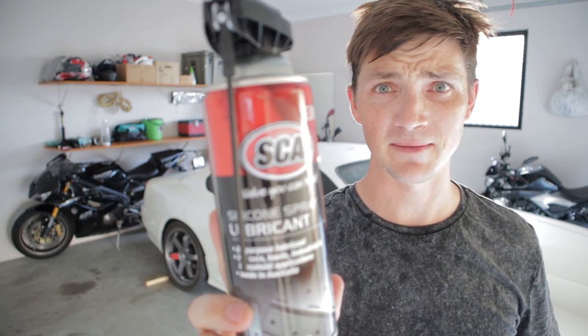For now there's a definite improvement, and I'm sure you can see that — particularly the right belt is now retracting way faster, and there's even an improvement in the left belt which wasn't really slow. Thank you to my subscriber who suggested this fix. If your seat belts are doing the same thing, you can grab yourself some silicone spray — I don't think it really matters what brand you get, just as long as it's silicone spray. Spray that on the inside of your belts like I did and see if it fixes it. It's not sure to fix all belts — if the retracting mechanism is broken or really buggered, this probably won't help you.